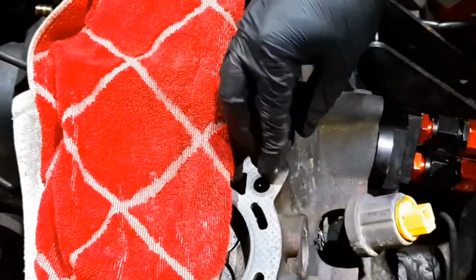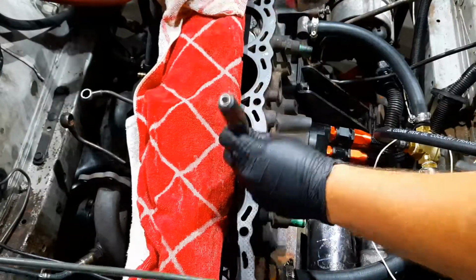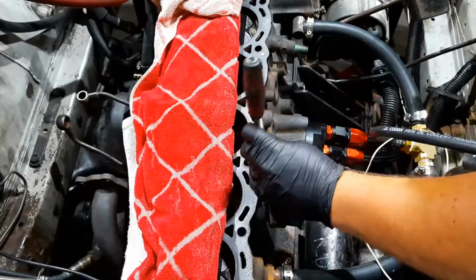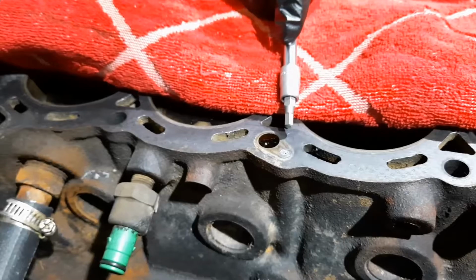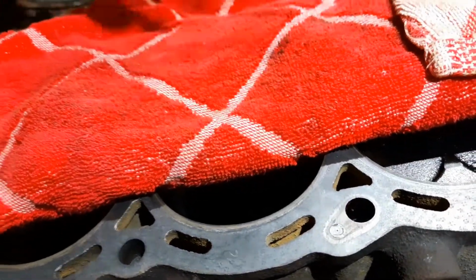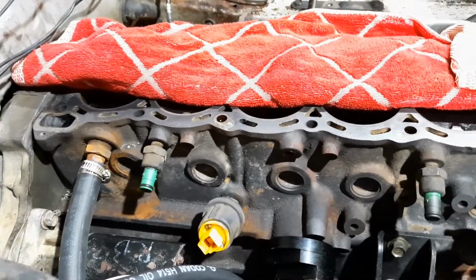Going that way, see that way it sits in there and it starts. If it goes in there, we're in big trouble. So with our 2 restrictors installed, we've got the 1.1 in the rear and the 0.9 in the front. That'll keep our oiling issues under control. More oil in the sump and less oil in the head means happy drifting.